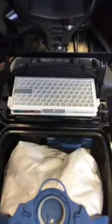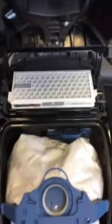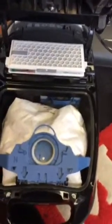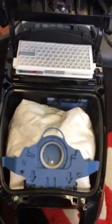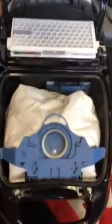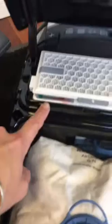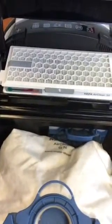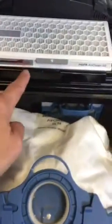That HEPA filter is this little guy. This is one of the Miele canister vacuums — see here behind the bag? This is the HEPA filter. That filter is good for 50 hours worth of use, about an hour per week. So after that period of time, it loses its effectiveness — it's all filled up with debris and it has to go. You can see on the new machines these filters have a little time strip on there that gives you the indication after that time has elapsed that it is time to be replaced.